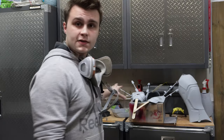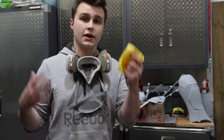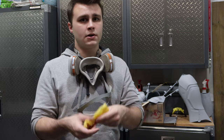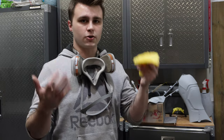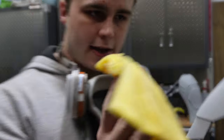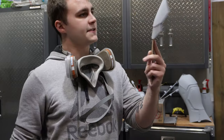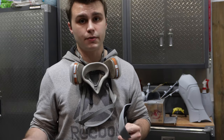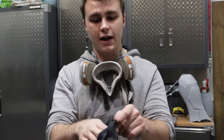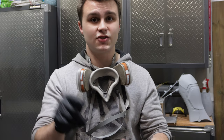I have all my parts laid out here in the shop. One thing I'll be doing before I start painting is using a tack rag. This is just a very tacky rag - you can get it at most auto shops like Napa. These are used to wipe down the surfaces of whatever parts you're painting before you actually paint them, to get rid of dust or any debris that might have built up. Just wipe away any dust from the surface just like that. Now that it's nice and clean it's ready for paint. And don't forget safety first - I have my respirator, goggles to protect my eyes, and a latex glove on my non-dominant hand so I can manipulate the part without getting overspray on my hand.